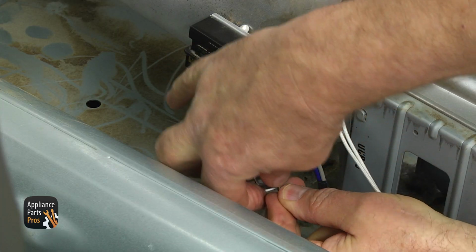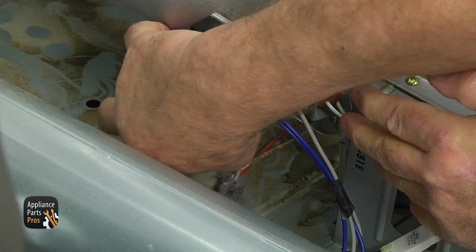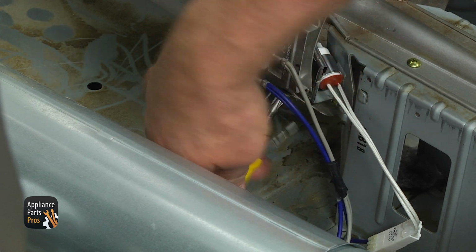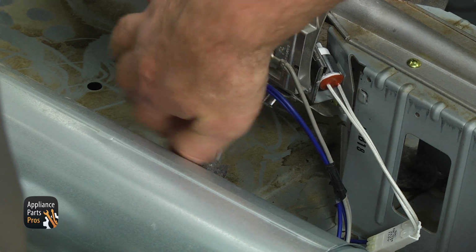Place the one leg of the new high limit thermostat in a cutout just the way you did with the safety thermostat, and then align the holes and install 2 Phillips screws. Again, connect the wires, and again, the order is not important. Don't relax just yet. This heap of metal and screws is far from a working dryer. You've still got some work to do.